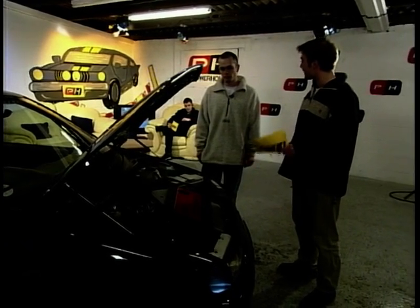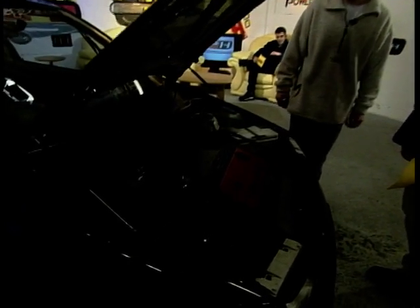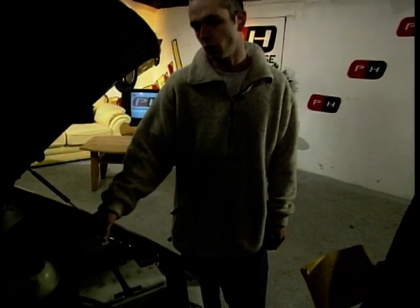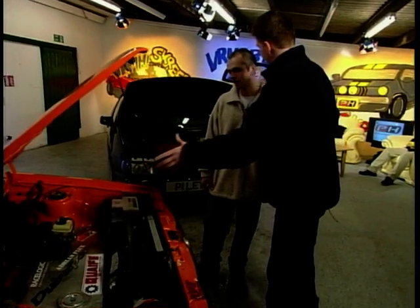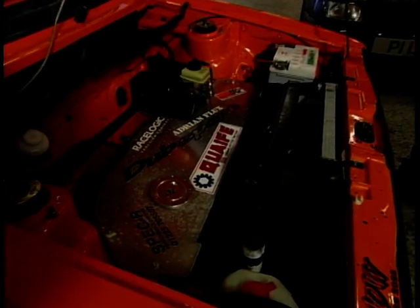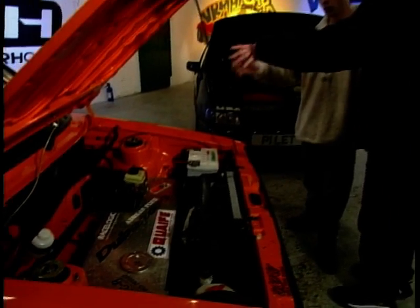The Germans and the magazines said it couldn't be done. So how did you do it? We got a brand-new car, took it to the workshop, took the original one-litre engine out, and then started work on fabricating the engine bed to take the VR6 unit. It's a lot heavier engine, and it's also a Polo engine mounted on the inner wings, so we had to fabricate an engine bed to take the weight. We put the engine in the back in this one and put a fuel tank in the front, with the radiator at the front to cool the rear engine.